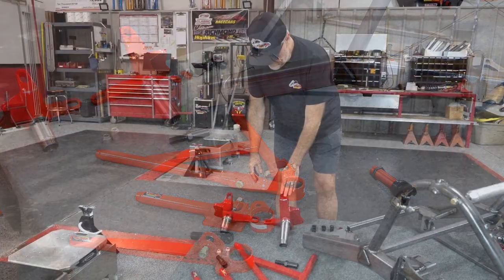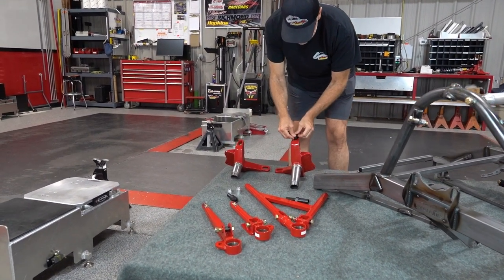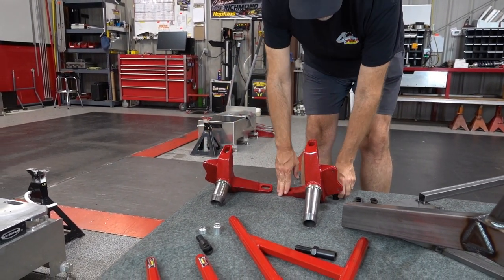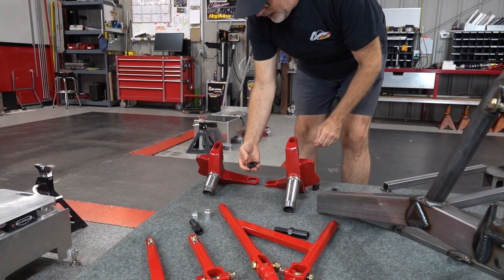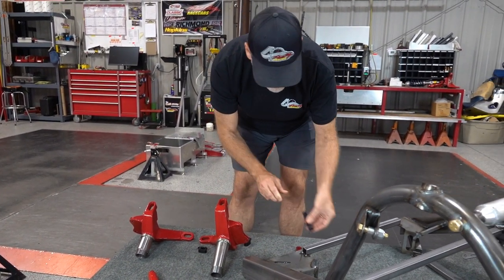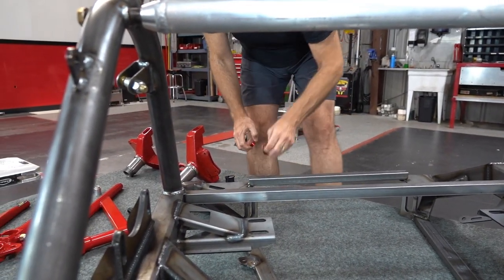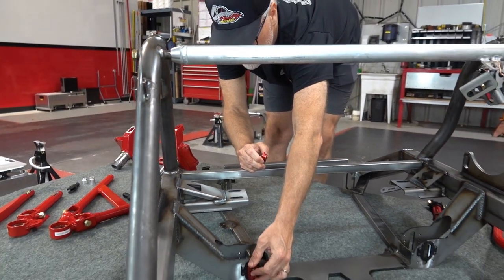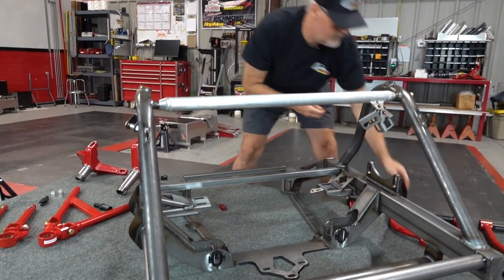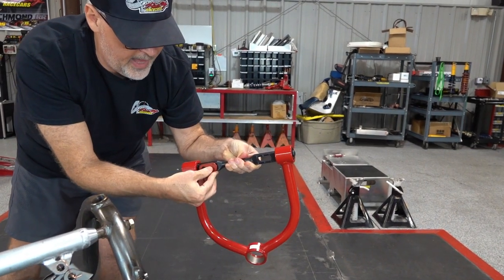Spindle-wise, you have your choice of wide five or five-by-five spindles. These are a slug top where you can change the degree — like 5, 7, or 9 for example. The steering arms are also slugged, so your Ackermann is adjustable. The complete slug package will be included — your rear strut slugs which change your geometry, your front slugs which fit in the crossmember, and this is also your caster slug for your upper A-frame shaft. This is milled out and the flat slug fits in there to help keep your caster locked in place.